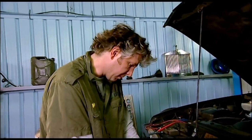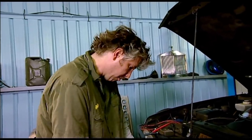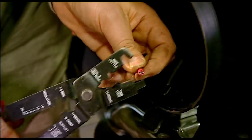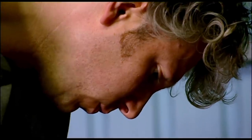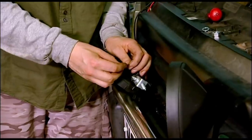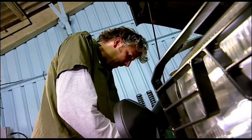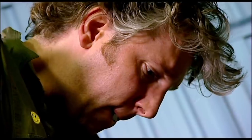The power is going to come from a relay, but the earth could potentially go onto this metal bar because that's bolted to the bumper which is bolted in turn to the chassis. So I'm going to wire each of the spot lamps to this bar for earth — nice and easy. It saves me wiring the rest of the car, and then the power feed is going to go off to the relay somewhere in the car. There are two terminals on a battery: positive and negative. In any electrical circuit on a car the load is connected between them. On a negative earth car the minus terminal is connected to the chassis and the positive is routed to the fuse box.